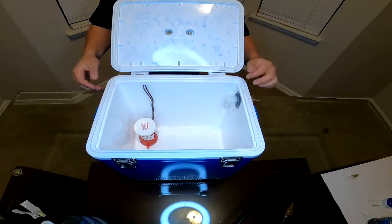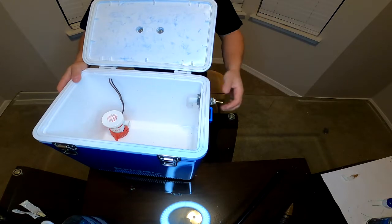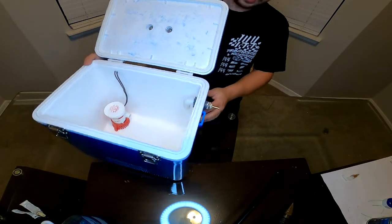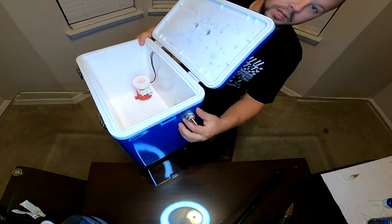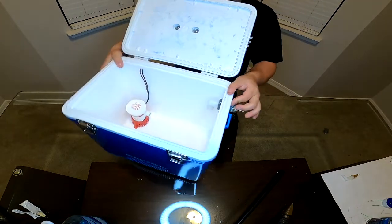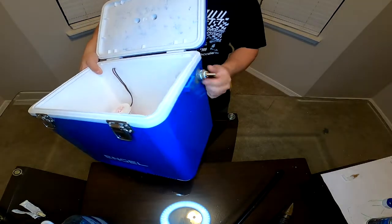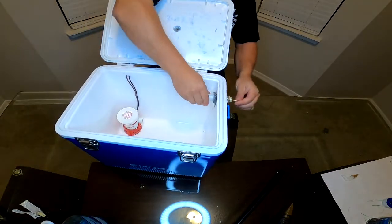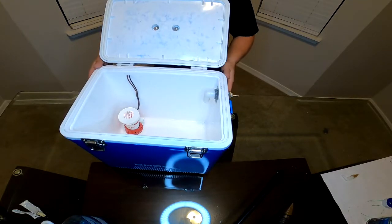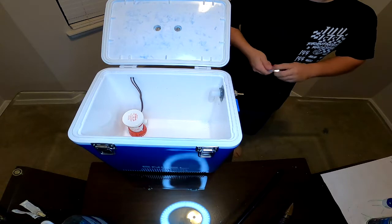Alright, so we have these fittings in. I put a bunch of JB Weld around both sides. What I had to do was thread this 90-degree fitting into the cooler like you saw, but I actually had to make a bigger opening on the outer skin to get this fitting to go inside the housing here. It sandwiches this inner liner and then I just filled that void with a bunch of JB Weld. It's extremely strong — this thing's stout, it's not going to go anywhere.